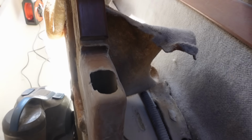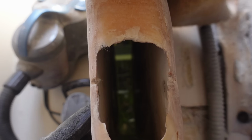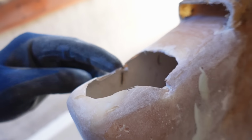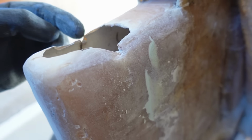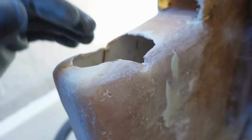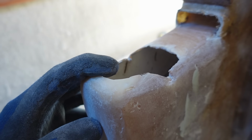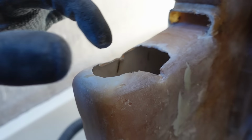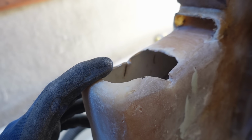On this, I'll start from the top and work my way down. So there's the ground below, and here you can see these little notches either side quite clearly. We tidied them right up, so that's where the compression post actually crunched down to. I'm assuming when they over tightened the rig, or when the mast was bent in transportation, if they strapped it down so hard, it compressed into this. And especially if that through hole was there, it wasn't providing a load of strength.